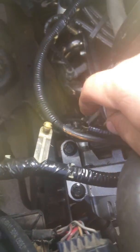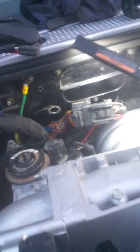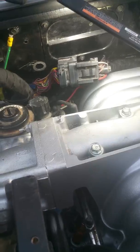I figured I'd make an updated video fixing a couple problems on my alternator circuit and the normal 99 alternator circuit, which is unplugged, runs through the engine harness, comes out at your C115 connector on the 95 4-cylinder stock Ranger harness. The alternator circuit is tied in with the brake light switch, and the harness is under the brake booster.